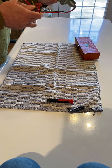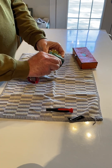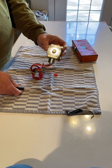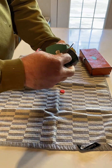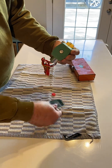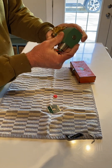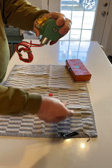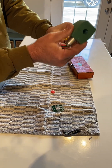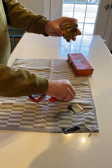I'm going to show you quickly how to rebuild an ASCO valve. This is the power head — there's an electromagnet in here. This is a little retainer clip; I usually use a little micro screwdriver to pop that off, just like that. This little metal plate is a bit difficult sometimes, but you can generally pop it off. It actually slides down and snaps into place. This metal plate is what holds the electromagnet in place — there's a little spring action where you push down and slide the clip over. When you pull the electromagnet or power head off, you're left with a little spring on top of the solenoid.